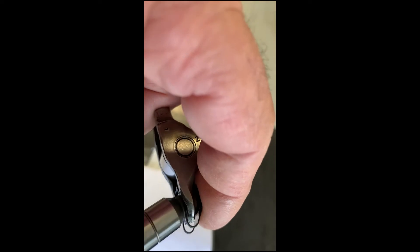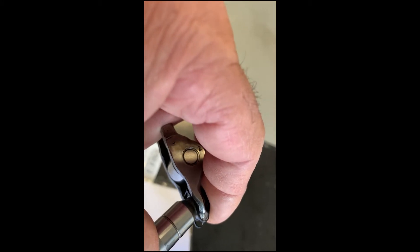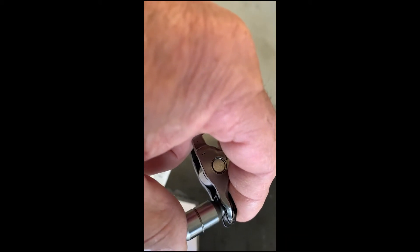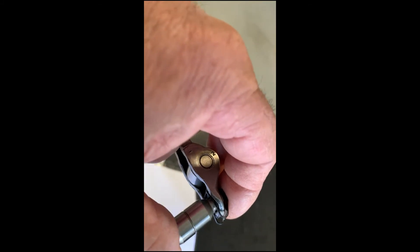This is mainly so they don't contact the bottom of the pivot. If you apply load on the pivot into the rocker and move it through its travel, it shouldn't be contacting the clip — that's pretty important. I find that some of them have been pulled on and often left loose, which I think is what might be going on. So it's important that these clips are tight on the rocker.